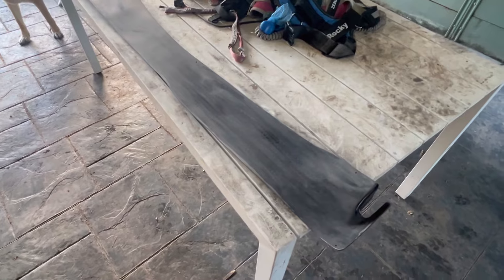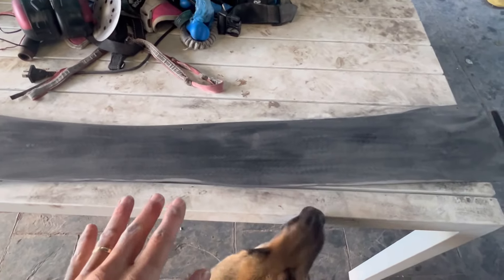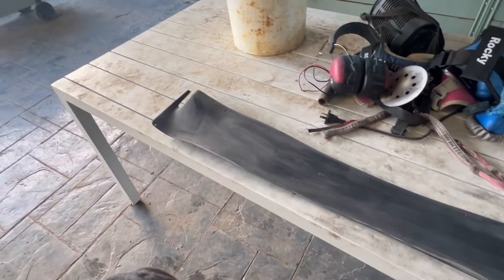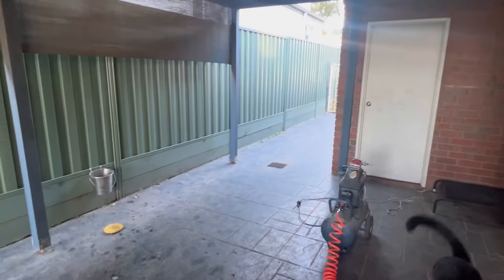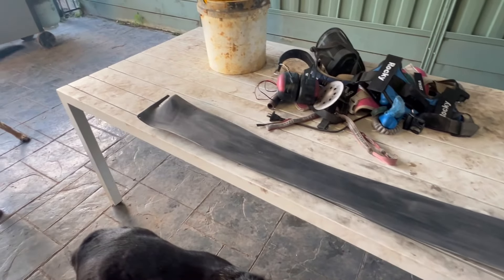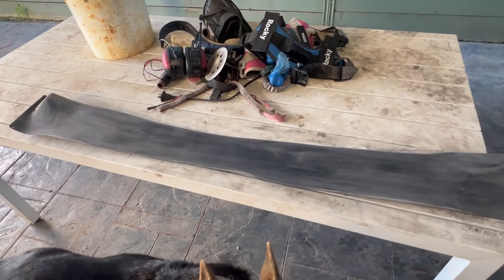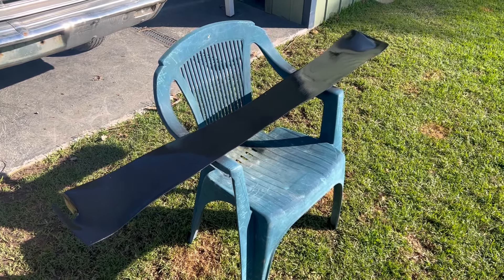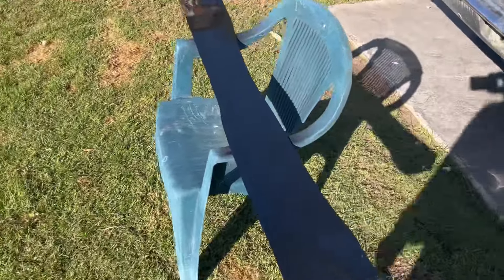Happy weekend — I finally got the chance to sand this back. It's sanded back to 400 grit again with the water bubbles out and it's ready to repaint after a clean. It's not meant to rain today but I don't trust the forecast anymore so I'm hanging it up under cover. I'll spray it with a rattle can this time — the only reason I used the spray gun last time was to match the trims with the rest of the car, but this one doesn't matter. Rattle can of satin black. Change of plan — it's too cold under cover so I've brought it out in the sun for a third coat and hopefully that'll be it, because this thing has been a right royal pain.